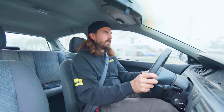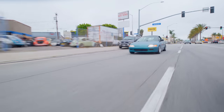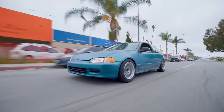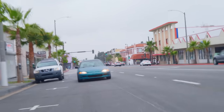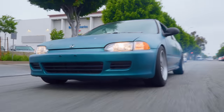Someone's pulling out in front of me — oh baby. Now we keep going, do it again and again. There's 50, let's bring her to a stop. You'll notice the braking getting better and better. Oh yeah, big brakes! Coming up to a red light, better come to a stop. You can hear I locked up at least one of the wheels there — as soon as I heard that I backed off, let the wheels keep spinning. They're starting to bite. Starting to smell the brakes a little bit, which is good — that's how you know they're getting nice and warm. And that is bedding your brakes. These brakes are bedded and they are ready to rip.